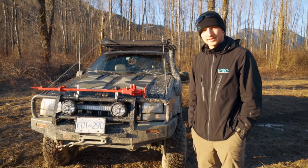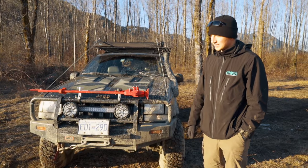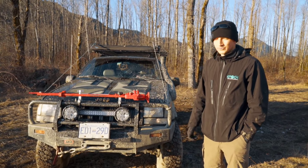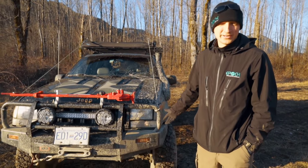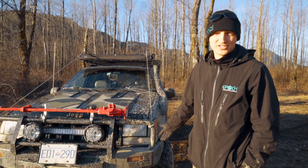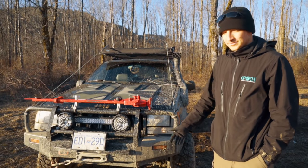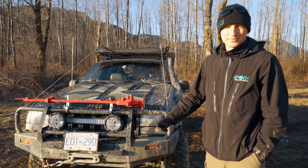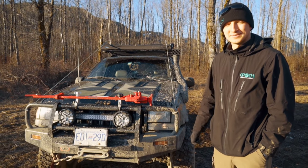If you're looking to get into off-roading, Grand Cherokees are the perfect vehicle. They offer a little bit more luxury than your XJs, they have coil suspension all around, and some like this one come with 3.73 gearing so you can automatically run 33-inch tires without any power problems. Parts are available widely — anything can be replaced for extremely low cost. Very sustainable, let's put it that way.